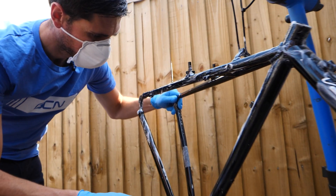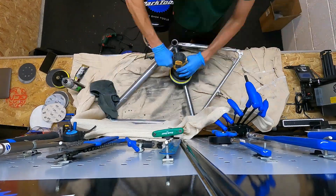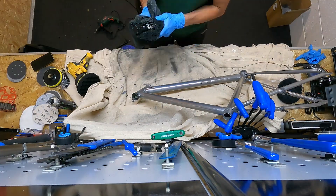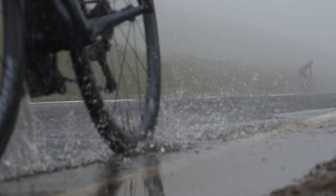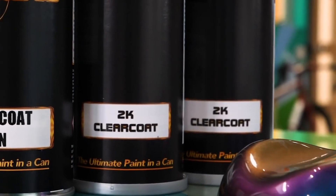While I wait for the paint stripper to work its magic, let me give you a quick explainer on what sanding the frame is actually achieving. By sanding the frame, I'm smoothing the surface on an almost microscopic level to get rid of surface imperfections. Super close up, this is what the surface would look like — all rough and bumpy. Every time I sand it and then change to a finer or smoother sandpaper, the surface also becomes smoother. This will give the frame its distinctive silver and chrome mirrored shine. It will be susceptible to oxidization over time, especially if left damp and dirty, which is going to cause the frame to look dull. To combat this, you could lacquer the frame when you're finished, or just give it a polish up now and again.